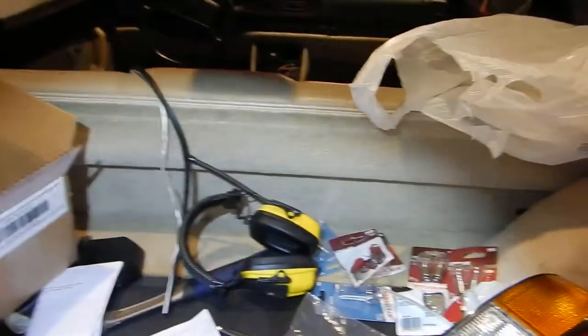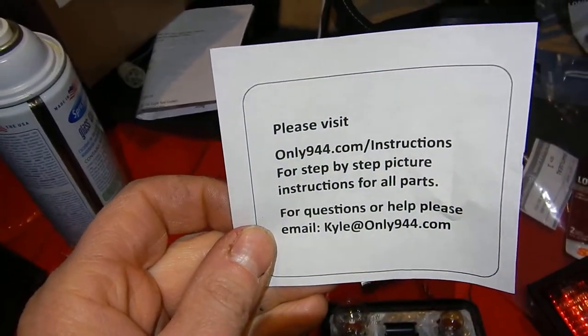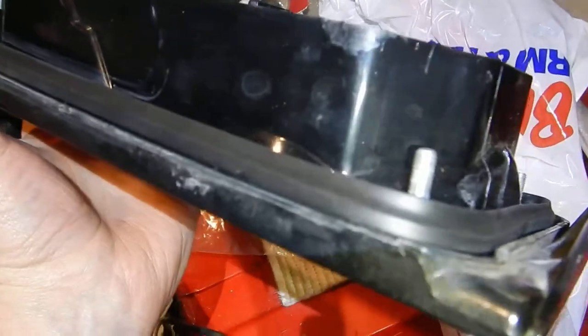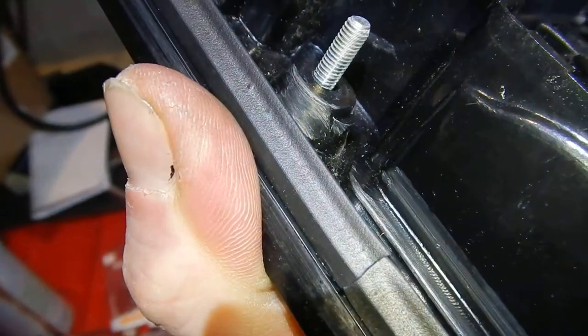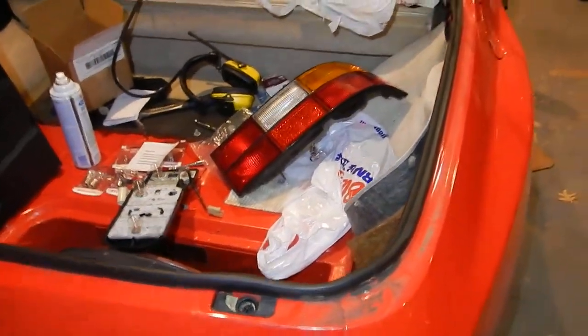You want to get it all off as clean as possible. The seals I got came with a little instruction guide from only944.com. They have a peel-off adhesive back. I've already done this side — that's what the new seal looks like. It's going to be long so you'll have to cut it to fit. I started at the bottom so in case there's ever any water it'll at least drip out. I put a little dab of super glue on the seam to seal it together.